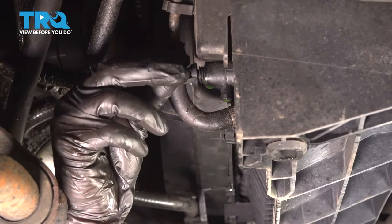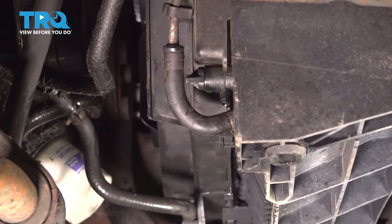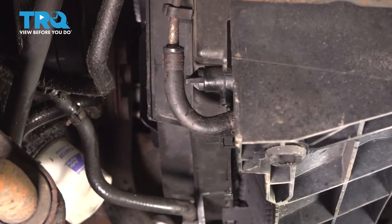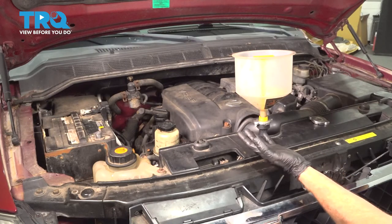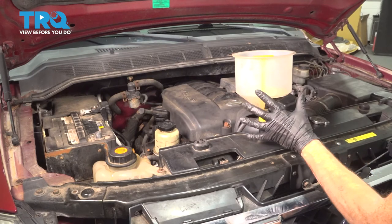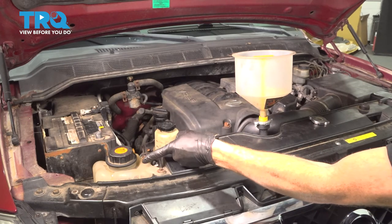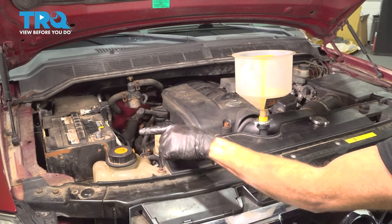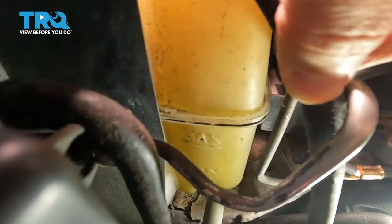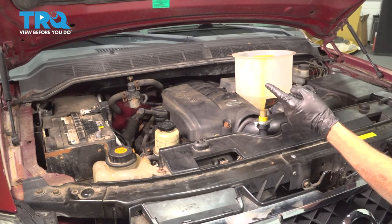Continue on underneath the passenger side of the radiator. Make sure that you close off that drain. Once you have it closed, continue on by drying off the area. If you had a splash shield underneath this area, reinstall it now. Now we're going to start filling the cooling system. Over the radiator, make sure you have some sort of funnel system to help burp out any air that's in the cooling system. This is actually a pressurized overflow tank, so continue on by filling the overflow tank up to the maximum line. Once you've finished there, continue on at the radiator and fill it. Once we feel there are no air bubbles coming out of the system, go ahead and run it.